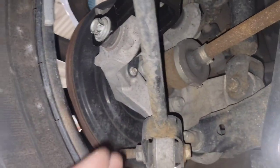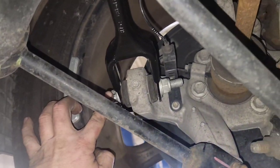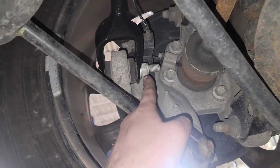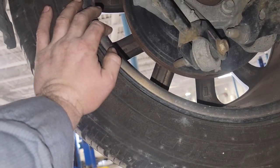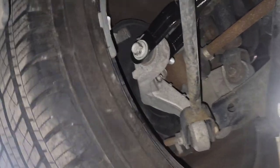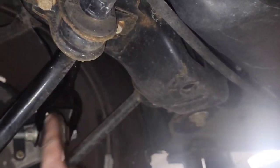When you get on the alignment rack, leave this kind of tight while you're on the rack. When you drive down to the alignment rack, take a 21 millimeter and an 18 millimeter wrench and, while it's on the floating plates, you can push your hand right here and bring it into alignment. You'll need one wrench hanging down as your stop and tighten with your free hand. You can get a helper, a lube tech, or a porter to grab the wheel and hold it while you work together. I do it by myself — that's how I get these in alignment.